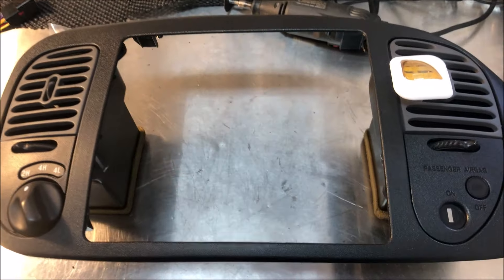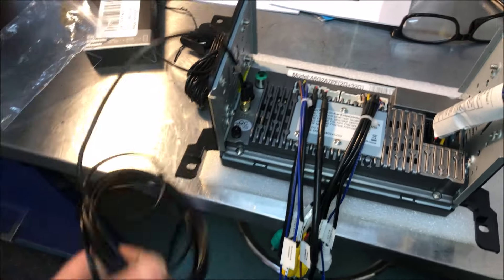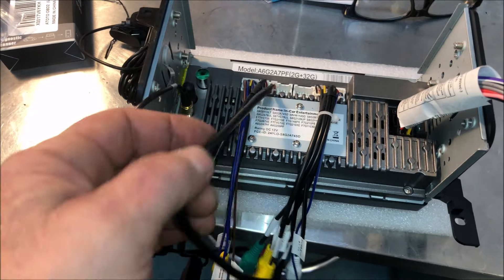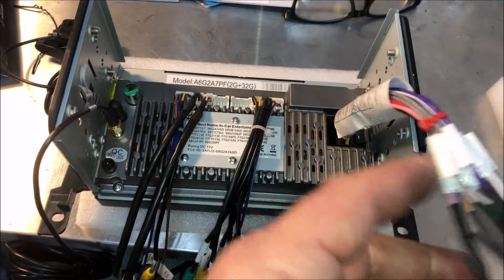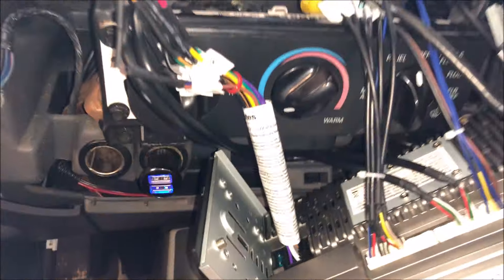Everything is assembled on the radio bezel — the airbag switch, the 4x4 switch, even my air freshener. The instructions recommend painting the vents, but I'm going to leave it for now since it's winter and not a good time to paint. For final prep of the radio install, before you put the panel on you want to install the GPS module — this communicates with satellites for maps. You've also got your backup camera, two USB ports (one for a peripheral like the tire pressure sensor, one for the phone), and the external mic connection. It's quite a spaghetti mess of wires, but I've got everything routed in.